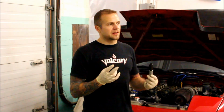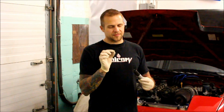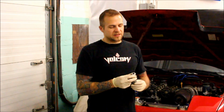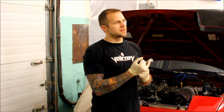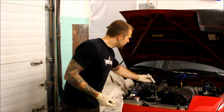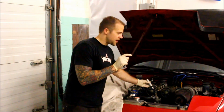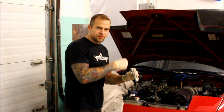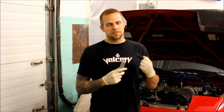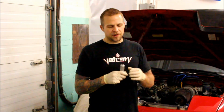You order it from Summit, and it supports 2 different sizes of valve stem diameters. From my understanding, this is magnetic on the inside of the tool, and you have it lined up inside where your valve spring and retainer assembly are. You give it a good whack, which will break the keepers loose, and the magnets will grab the keepers as you compress the retainer assembly and allow the keepers to come free.